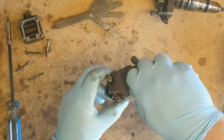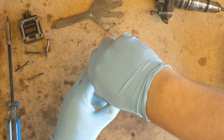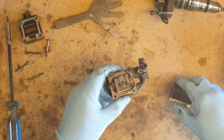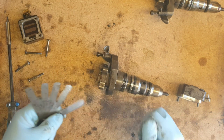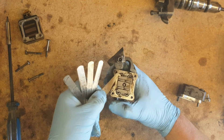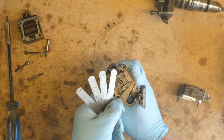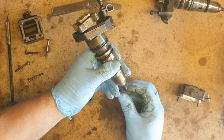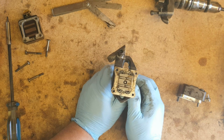This injector I already know is bad — I've checked it. I'm just going to show you the difference. This one came out of an engine exhibiting the same symptoms: cold misfire with sudden clearing up. Here's the one and a half thousandths feeler gauge — it'll go under that corner and then it gets too tight, barely gets under there. It won't make it all the way under anywhere around it. So this one needs to be sent out and rebuilt. There is a company — I don't remember the name — that does remachine the poppet valve and seat. They're in California somewhere, I think it's Anaheim.